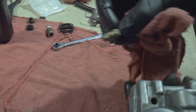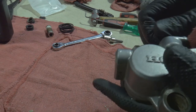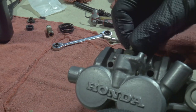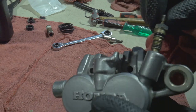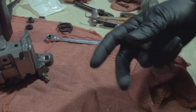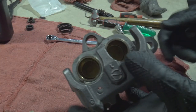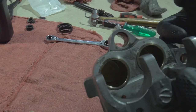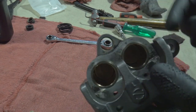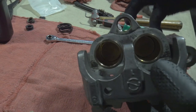If you want to put a new O-ring on your bleed valve, go ahead and do that and reinstall it. The goal is to try to seal this caliper off from any further contamination. That whole slide mechanism — those pins and stuff — you're going to grease all that up. You really don't want any external grease hanging out around the caliper because grease on brakes will collect dust, brake pad material, and all kinds of crap. To keep everything as dry as possible is key. No grease hanging outside of seals when it comes to that slide. Keep everything clean and dry with grease internalized.